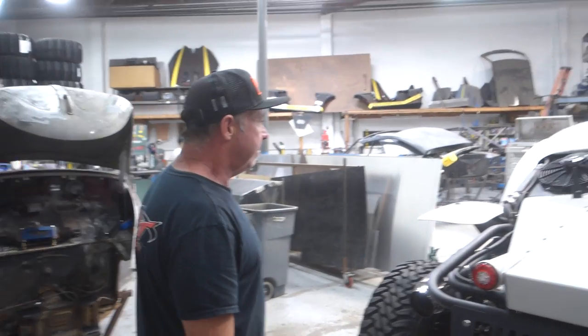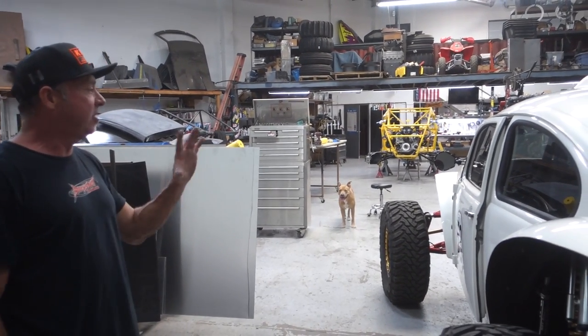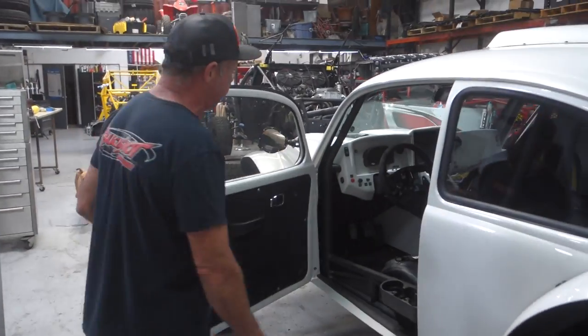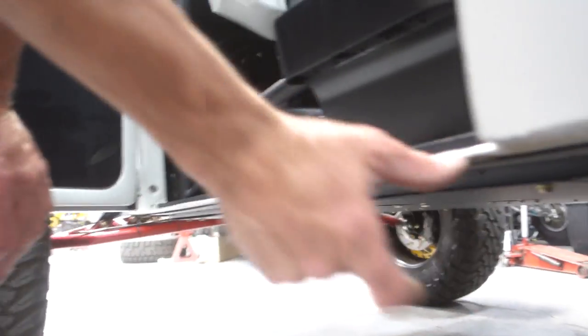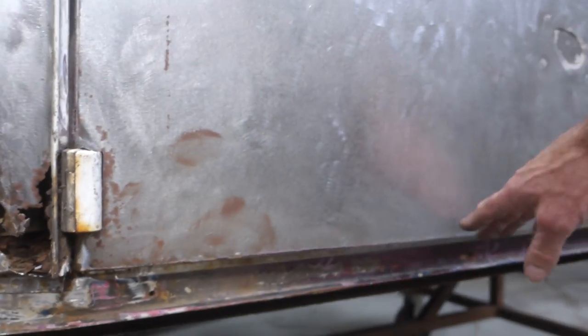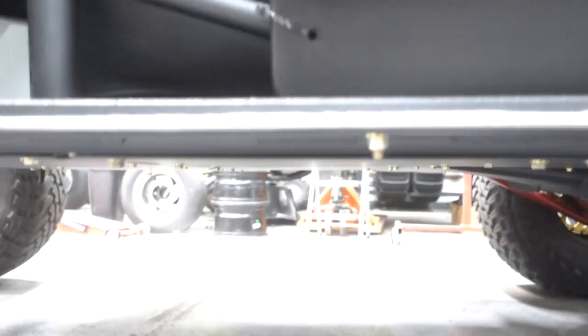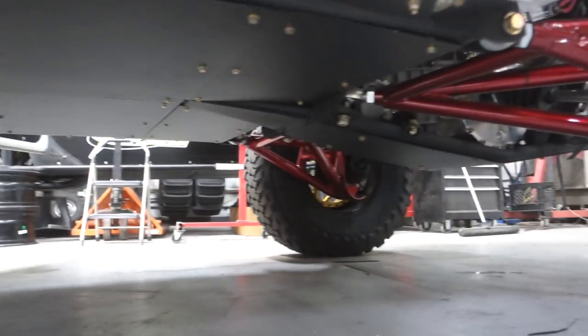What was the most challenging part of building this car? The windows were the biggest problem — getting the glass in there was a big challenge. And then just getting the body to fit with the roll cage tight inside the cab — it's not easy. Also, I cut the bottom of the chassis off to get rid of that ugly return section on a bug. I just put a plate there that bolts right to the chassis, so it makes a real solid setup and it looks a lot cleaner. It also gives you some ground clearance, and when you look at it you can see it's perfectly flush. When you bottom out you're not getting caught up on anything.